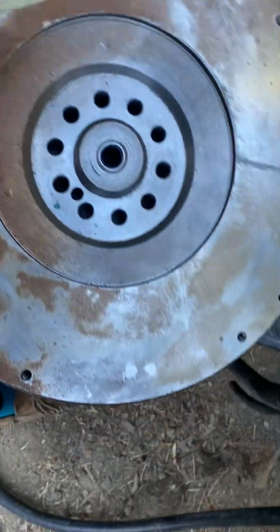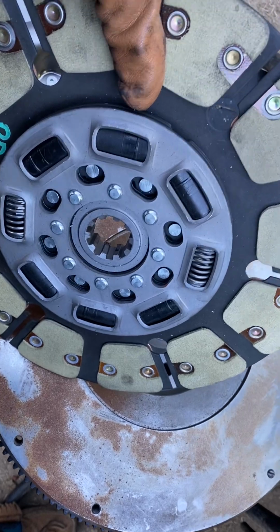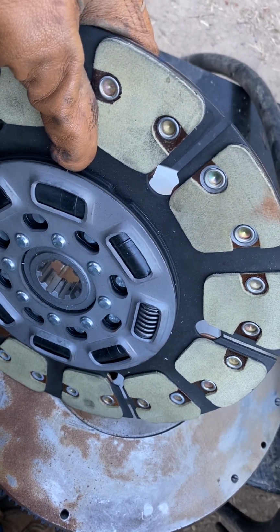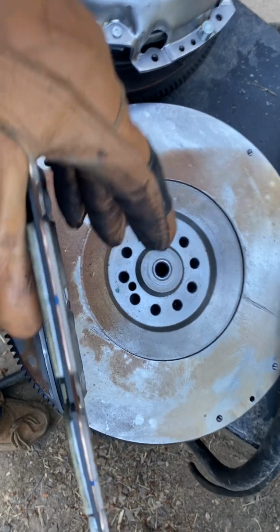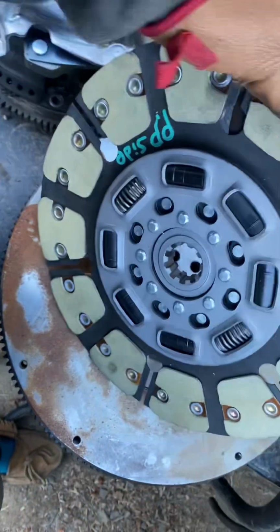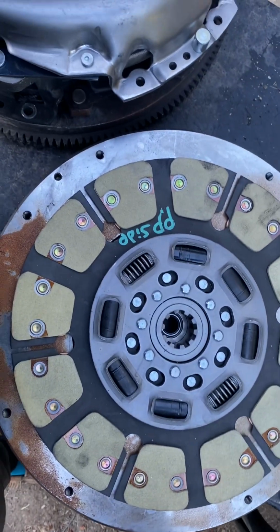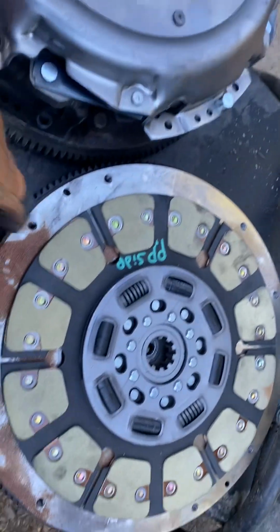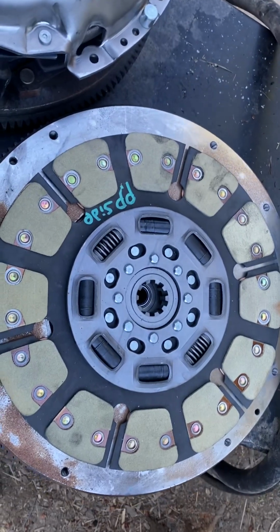And then another really neat thing is this one, I got a Spicer clutch. So this has got Kevlar and ceramic pads. On this one, you can see the little pads, and the pads are smaller on this. The friction material is much better than it was on this other one. So then it allows you these little gaps, and so it stays cooler.